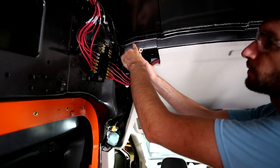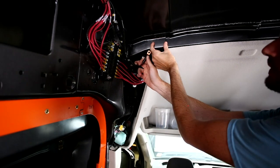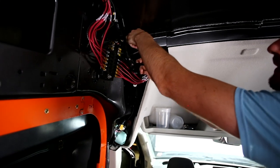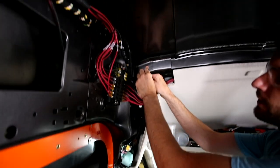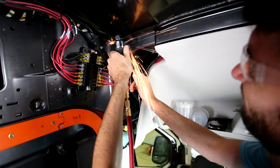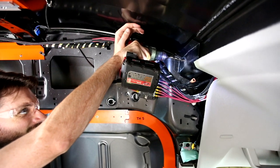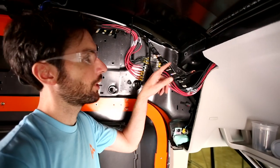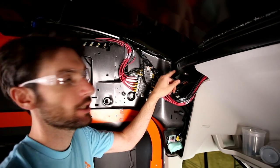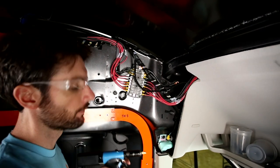Just a thing to keep in mind here: when you're drilling, this inserts into there, so there's a double layer of metal until right about here. Reach behind and feel where it becomes a single layer and go in that area so you're not drilling more than you need to. This is pretty much the only place where you don't want to put sealer in the hole right after drilling — we need a good metal-to-metal connection, so insert and set the rivnut before applying sealer.